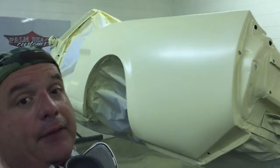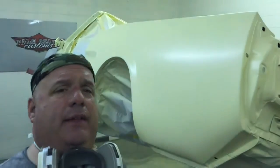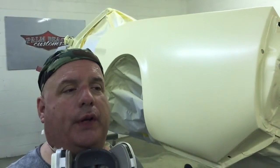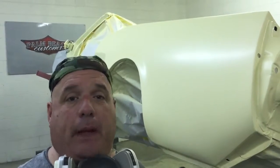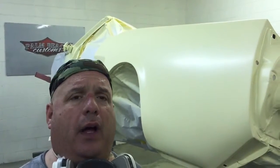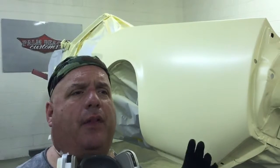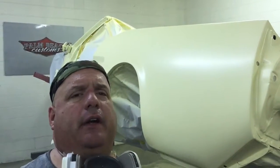What we have here is just the body on the rotisserie ready for the final clear coat. When we clear these, on the high-end restorations we'll put maybe a gallon of clear on the project, maybe a gallon and a half, let them bake up, and then hit them with 600 grit. We clean them all down and then give them another gallon or two of flow coats, which flows the clear out.